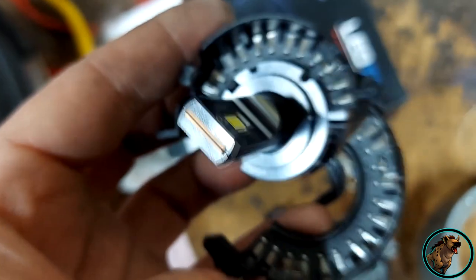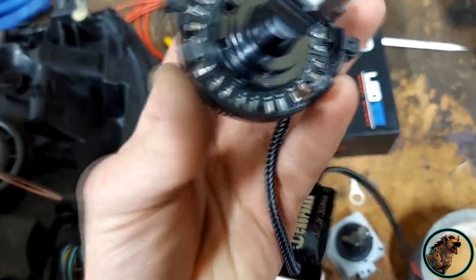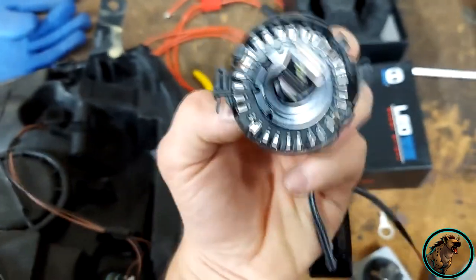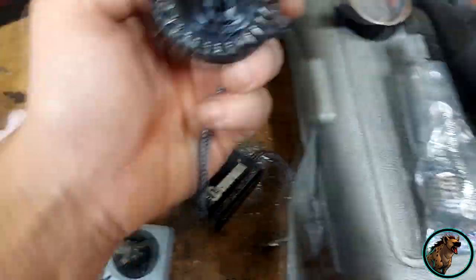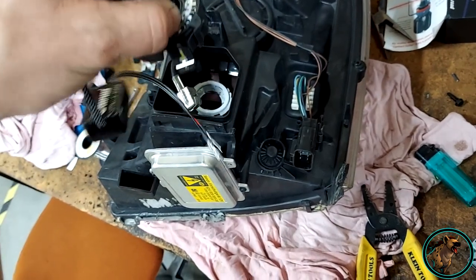You move this collar over here — sorry, it's kind of hard to do with one hand. You do the same thing and then lock this in. These things fit a little loose on there, which isn't ideal since it's not as tight as the factory bulb. What I do, because once you lock it in it's still kind of loose, is take some RTV and put a dab here and a large dab there. That way when I put it in and lock it, it'll dry up and hold it in place, keeping it from vibrating loose.